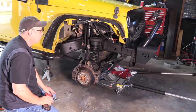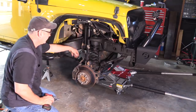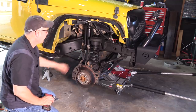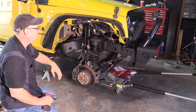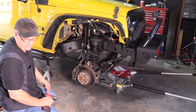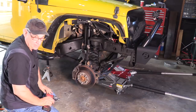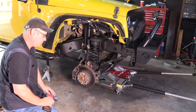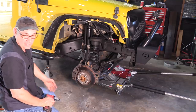Some things we've got to do for this: we've got to take the sway bar link off and take the shock out. We also have to take the brake line and ABS sensor off so that when we drop and get the spring out we don't have any issues. I'm not going to go through a step-by-step process with torque specs and everything — there are a lot of videos online that go through that — but we're going to show you some of the stuff that we're doing as we go through this.